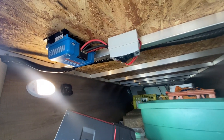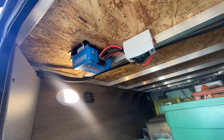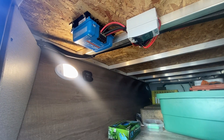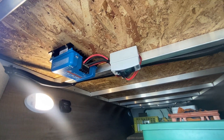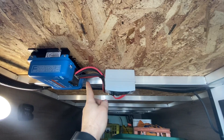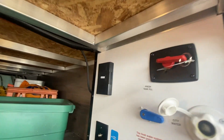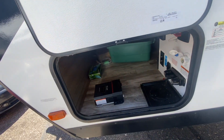Over here in the storage compartment, we upgraded to a Victron MPPT solar charger from the stock Furion charger — which is a 25 amp — this is a 50 amp — and the reason we did that was we added a whole bunch more solar. We also added a solar disconnect, which was not there before, and we just wired this directly into the positive into the disconnect, so that still works, and hit the negative on the frame rail there. That's making great power.